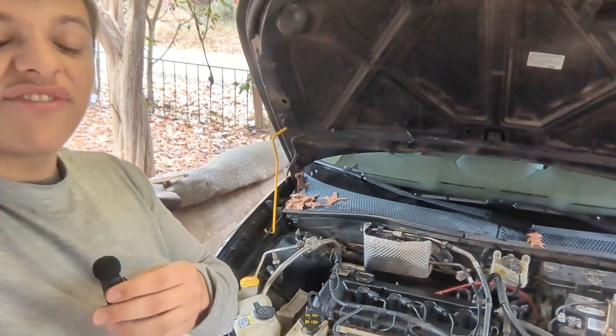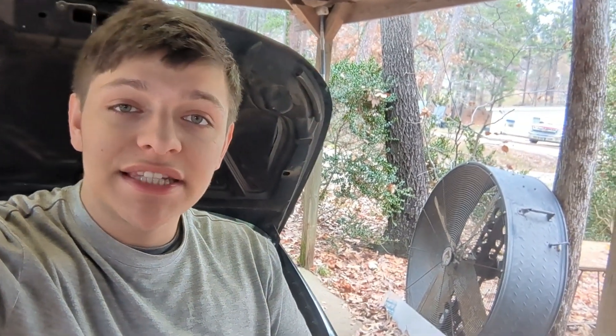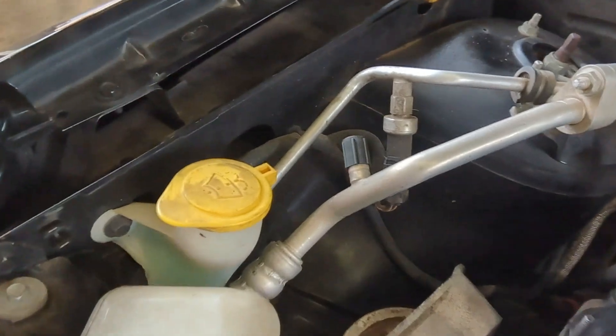Hello and welcome. This is my 2008 Ford Focus, and like a lot of Focuses from 2008 to 2011, it's got a pretty annoying issue. That issue is the fact that the passenger side motor mount has failed. Now that's not a huge deal because the engine's not going to fall out while I'm driving, but it does mean that the motor mount has lost pretty much all of its ability to absorb vibrations and shock from the engine. It's actually filled with a fluid very similar to what you'd find in a shock absorber. Just like how your car's suspension absorbs vibrations from the road, the engine mount absorbs vibrations from the engine — and unfortunately, it's just not doing that anymore.